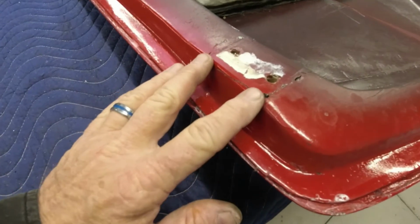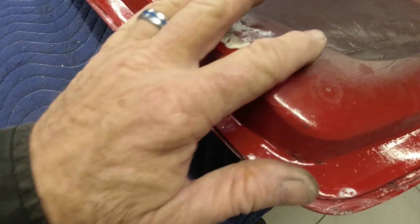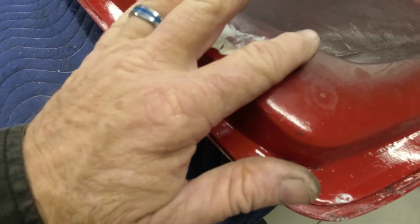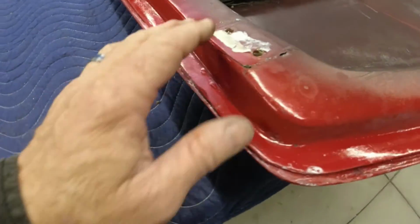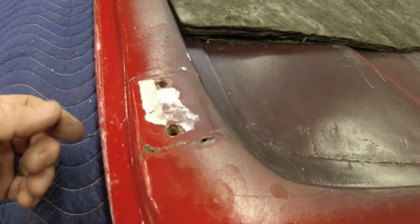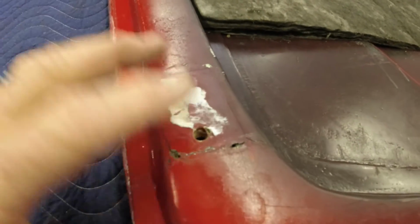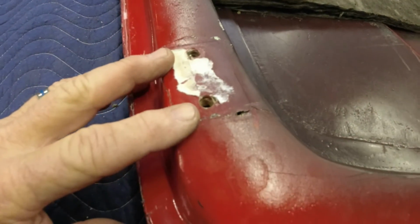And you want it to be mainly the fiberglass fiber. You don't want to fill it in with epoxy. You want to really put the fiberglass in there. That's where all your strength is. If it's epoxy, it's just like a piece of glass. It's going to break easier than if you have a bunch of strings going through that piece of glass, kind of like safety glass. So keep that in mind when you're working with fiberglass.